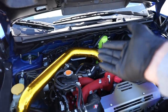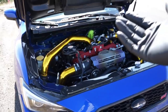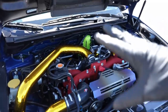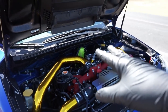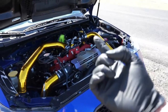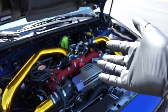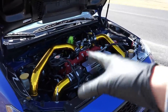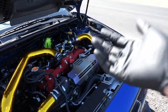Motor is still going to be staying. We are going to be putting an ETS rotated turbo kit on this car, as many of you have probably seen on this channel. He bought that from Chandler — Chandler did part out his Series Gray, unfortunately. We are going to be putting a 6466 with a 105 housing on it, so we've got plenty of room to grow on this setup. This motor setup, we are going to be pushing it — it's a Stage 4, rated for 650. We have standard 11mm head studs in it, ARP 2000s, and a set of JE Pro Seals. JR knows that we're going to be pushing it. I'm really glad that I did push him to get the cylinder heads on this thing.